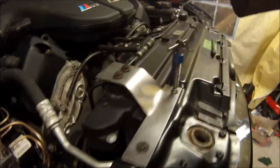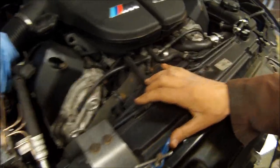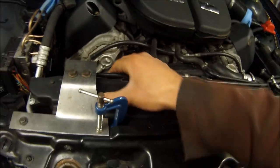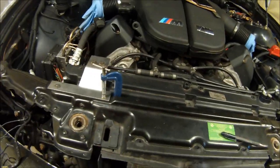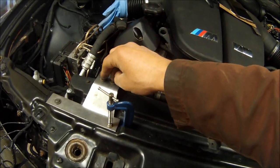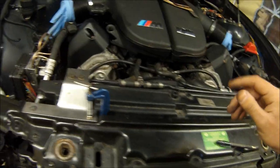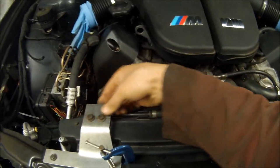I've drilled some 6mm holes and bolted into the anti-vibration mounts. I haven't drilled this hole yet so the G-clamp is just holding it, but as you can see there's a bit of movement in the radiator which is what you want, and it's pulling all the hoses away from the engine which is what I was after. I've had to use washers to get the height right because the threads inside the mounts aren't very deep. I'm going to look at trimming this back because it doesn't need to go as far now I know where I want to go.